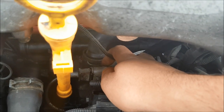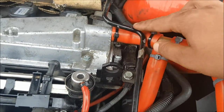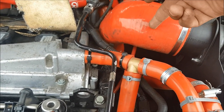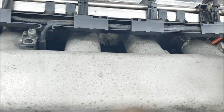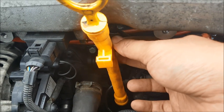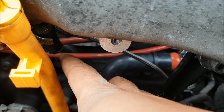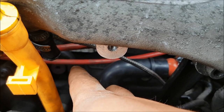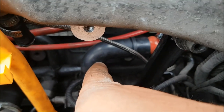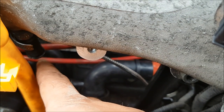Let me quickly explain what the original factory piping looks like. It comes up off the elbow, there's a T-piece off the elbow which houses the PCV valve. That then comes up and joins here, goes into a hockey puck which feeds back into the turbo inlet. On the underside there's piping which goes to the brake servo on this side, and also a little pipe that goes to the underside of the inlet manifold. I've just bunged that up. There's also a little L that comes off the inlet manifold and connects up to all of that piping from the elbow and the PCV system.